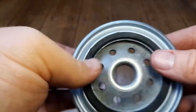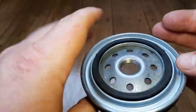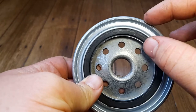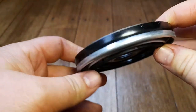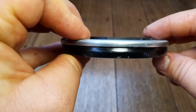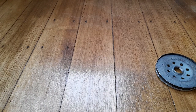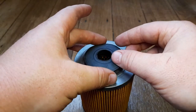The inlet holes I would say are reasonably small for the filter size, but that could possibly just be the design of it. It's got a fair bit of edge here, sort of a bit like a Z9. There's a lot of space in terms of overall thickness - it's not too bad, and the gasket's nice. Now where it becomes very interesting is something unexpected - the anti-drain back valve.